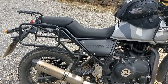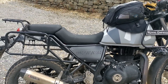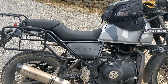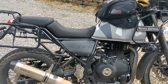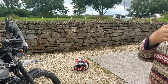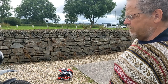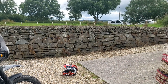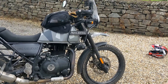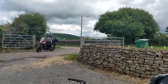The only thing I'd try is without the LexTech - I'd try it with a standard exhaust, because I'm still not personally a fan of the noise of it. I kind of like the subtlety of the standard exhaust. I'd be keen to try the cam on a stock bike. Anything you do to the intake or exhaust makes the mixture lean and the booster plug sorted that quite dramatically. The benefit of the Powertronic - as much as I didn't think it made much difference to power - it made the bike run cooler, which matters when going across America or in a lot of heat.